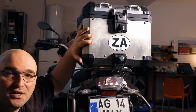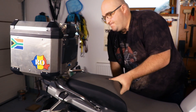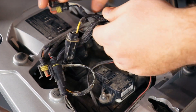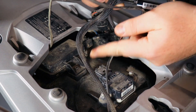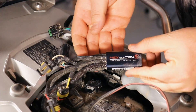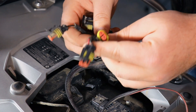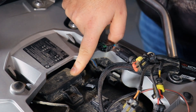The installation of the EasyCAN is pretty simple — as you can see it's already inside here. I bought this quite a long time ago but haven't used it to its full potential. This is the actual unit — one cable runs to the battery, the positive and the negative. You've got four outputs for all your auxiliaries: a separate horn, different auxiliary lights. We're putting brake lights in today. With two connectors you plug the Hex EasyCAN into the bike.